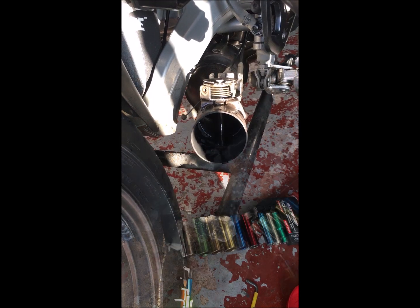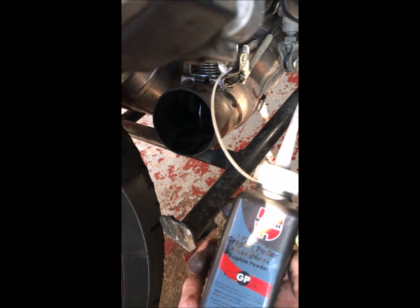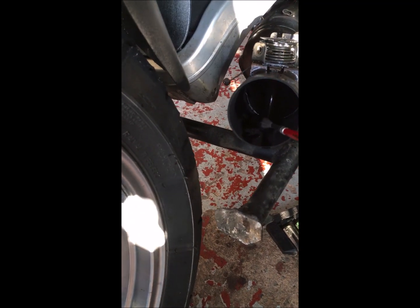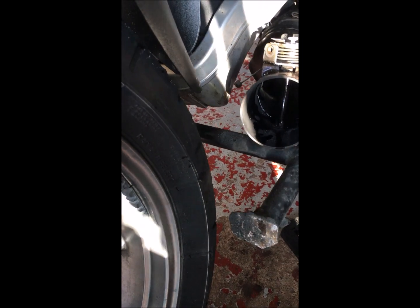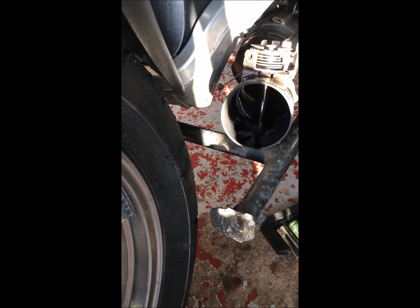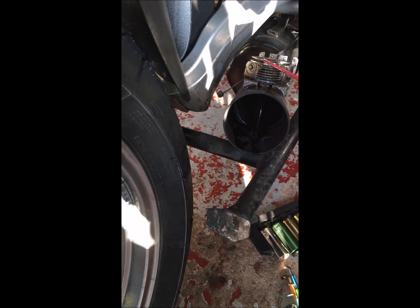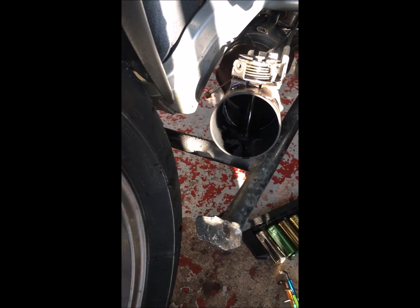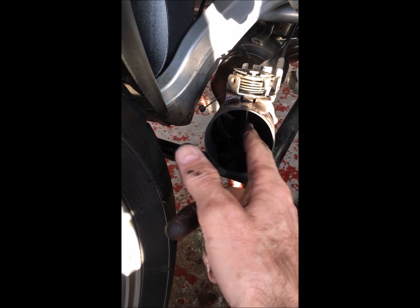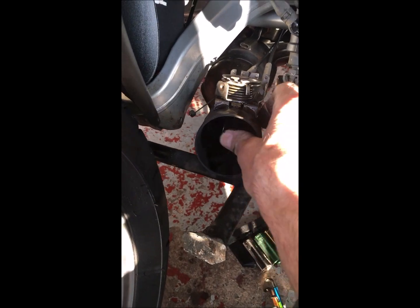But interesting. Okay, well, after about 5 minutes of fiddling this thing backwards and forwards, I've used the graphite powder, which is dead easy down the bottom, just to squirt it on, and with a paintbrush just to make sure it gets into the right place around the bearing and the seal. And at the top end I've managed to squirt some of the graphite through the top, and that worked pretty well on its own, but I've now washed it in with a bit of WD-40 from the top and from below inside here, and it's looking pretty good. And it's now returning back against the end stop here in the spring, so I'd say that's as good as new pretty much.